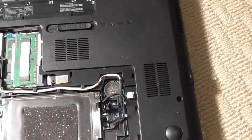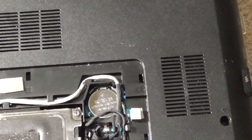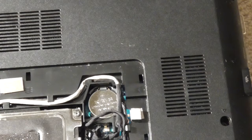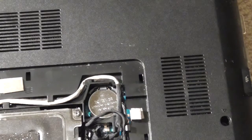Right down here is your CMOS battery. You could take this to HP or a computer store and pay about $50 to have them replace that $2 battery, or you can do it yourself — it just snaps into that little holder. The CMOS holds your clock data, so when you start losing your clock or the time resets, just go in and replace your CMOS battery.